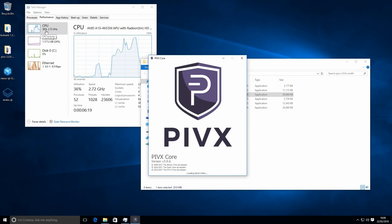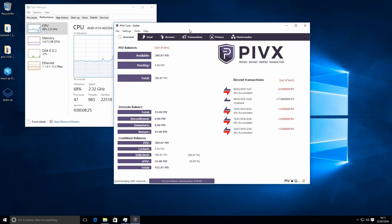There's a little bit of load on the CPU, only about 40% - I'm going to have a quick look under the desk at the wattage. It's up to 60% now. The wattage is using about 35 watts, which seems to be the peak. So maybe even at 100% load it's probably only going to use about 40 watts for this system. That's really good for the low power usage element, which was one of the things we were going for. Our wallet has opened up and you can see our balances.